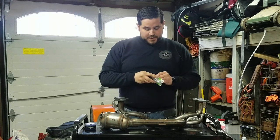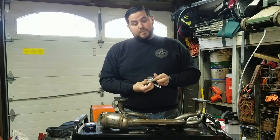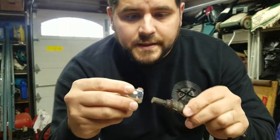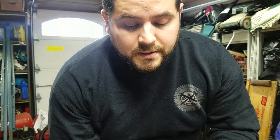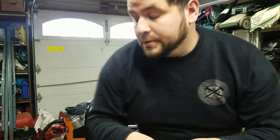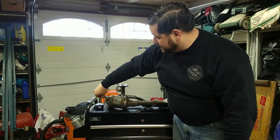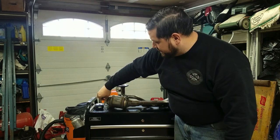I'll bring it up closer. We'll open it up and show you basically what it looks like. What you're doing is taking this — see how it doesn't fit — you're drilling a half-inch hole into that, and then you're going to screw them together like that, when all three are mated, and then screw it into the catalytic converter. Now, you might have clearance issues. I don't think I will — I just did this on my sister's car and we have similar setups.